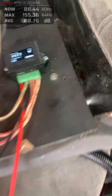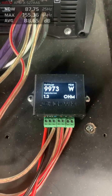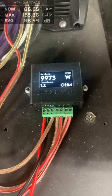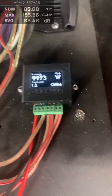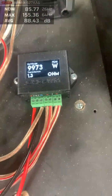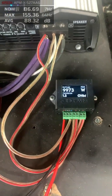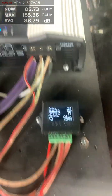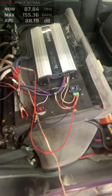Let's see how much power we got — goodness gracious, I was not expecting that! 9,973 watts on the Smart Eight. Good lord, we are wired to half ohm, after rise 1.3 ohm. The Taramps Smart Eight — damn near 10,000 watts out of it on a burp. All right!